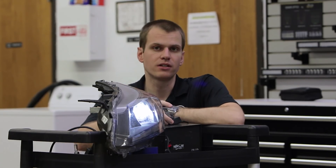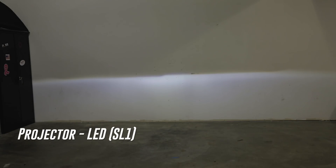Let's put in a good one — our Diode Dynamics SL1 — and see how it does. When we have an LED installed on this headlight with good focus, you can see our hot spot returns. On this one we have 780 lux, which is a slight upgrade from our halogen performance. Of course with the LED we'll get much more lifespan and the modern color as well compared to halogen.